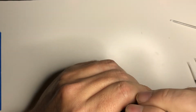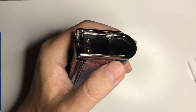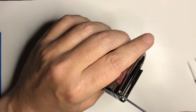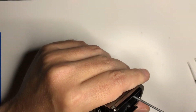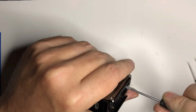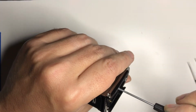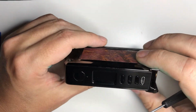So let's put this on. One screw. So if you notice, I backed out and backed in. It felt like it was getting ready to cross thread. And remember, these little screws are not meant to be fastened super tight. So just snug them up. Kind of try to remember what the feeling was when you were undoing them, and go 90% of that when screwing them back in.